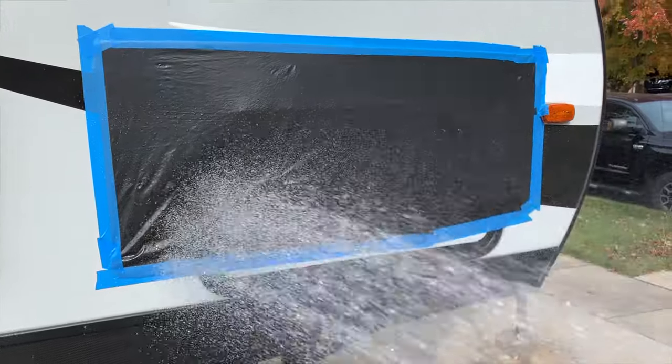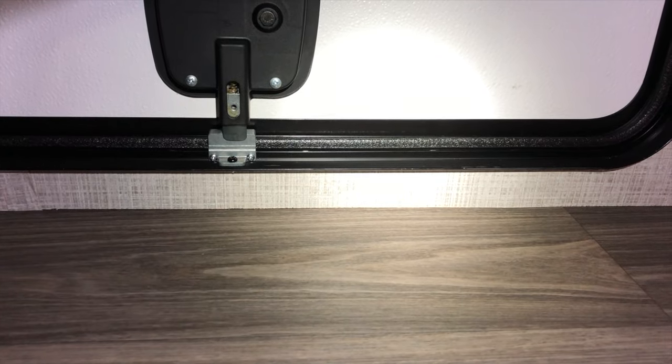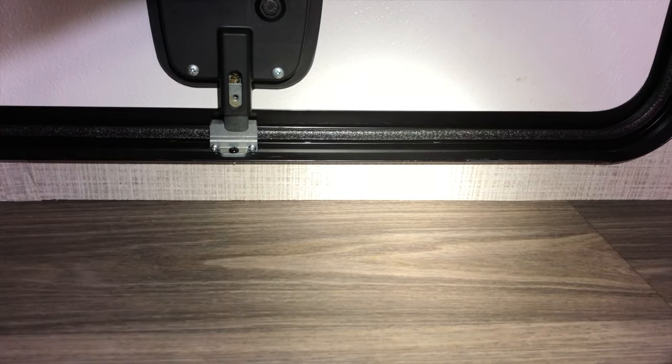So we applied a healthy portion of silicone around the back of the four screws that had been covered with factory silicone, and let the new silicone set overnight. We also placed a dry towel near the door as rain was forecasted again. That night we encountered a significant rainstorm. The next morning upon inspection, the towel had remained dry. Not being fully convinced, I again climbed into the cargo area and filmed while the lower door was soaked with the garden hose. After a good five minutes of spraying with no water showing up, we were firmly convinced we had solved the issue. We did one last test after removing the plastic from the upper portion of the door, which proved the solution had worked. We were leak free.